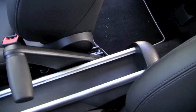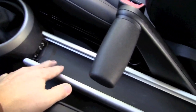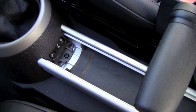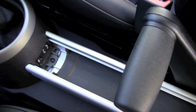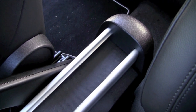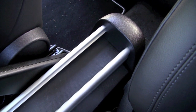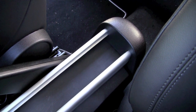On models that are equipped without the armrest, you have your rail system here. The first step is to slide back and expose the screws in this rubber pad that sits in between the rail, and then go ahead and remove it. We're going to be attaching a bracket back here in the area right between the two front seats. There will be a metal bracket that goes in there, and then we attach the armrest itself to that bracket, finished off with two pieces of black plastic.